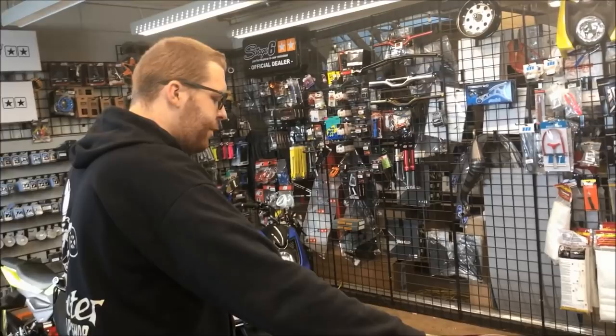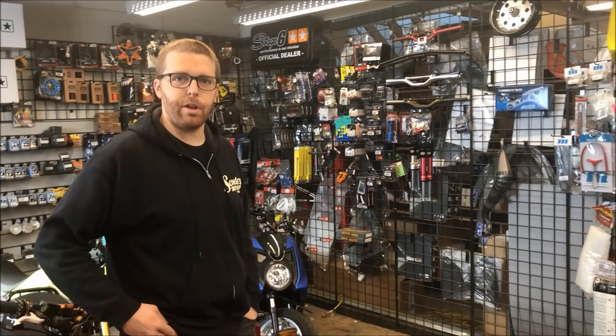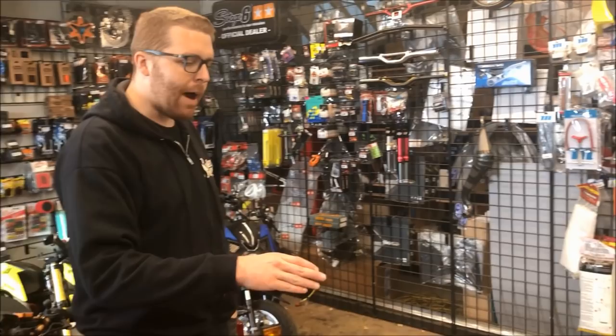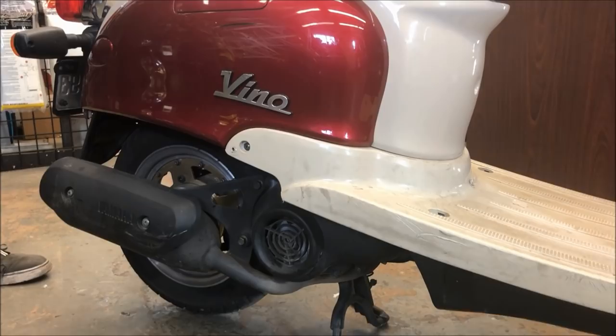That's exactly what I've done with this one. This one has a 70cc low-compression gasket, stock squish, so it's pretty low compression. I didn't check it, but the squish on the Malossi kits ends up being pretty big, like 1.1 or 1.2 millimeters, which helps the low compression, keeping the power band really low. Bone stock exhaust, stock airbox but with the snorkel removed. It's got a small Dellorto 17.5 millimeter carb.